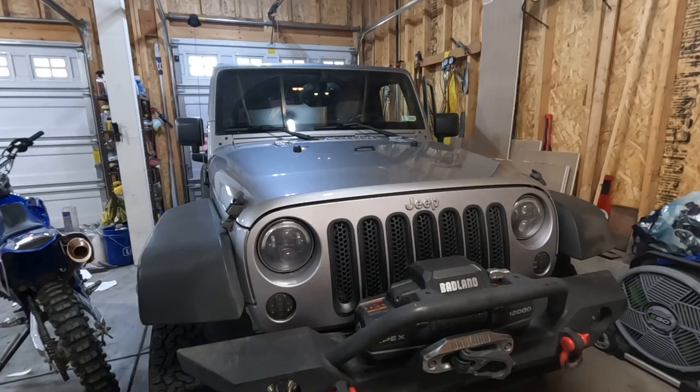What's up guys, welcome to the channel. Today we are on our Jeep JK and we are putting on a Baxter Performance oil filter adapter onto this Jeep's 3.6. The reason we are is because the factory oil filter on this Jeep is a canister type filter with no check valve, so all the oil when you turn off the Jeep runs down into the bottom of the oil pan. When you fire the Jeep up it has to pump all that oil up to the cams, and while it's starting waiting for that oil to show up it sounds like this — which we hate. This is our third time doing one of these videos and we feel really strongly about this system.